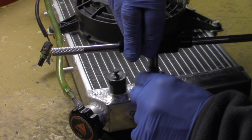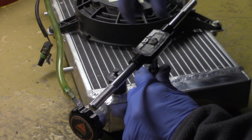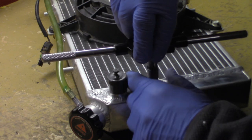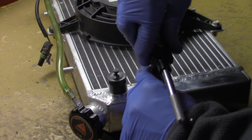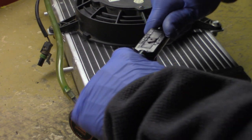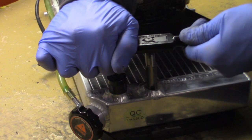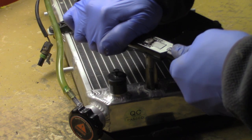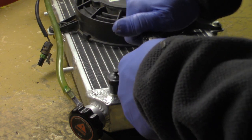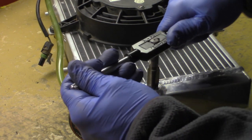And it may be a little awkward to get started here, but the tap actually is a little smaller on the end to fit a smaller hole where the actual tap tool starts tapping the hole in the middle of the tap. So if you get a little wobbly here at the beginning, it's not too bad, but you want to try to keep the tool as straight as possible, as long as possible, but you are going to be using a lot of force.